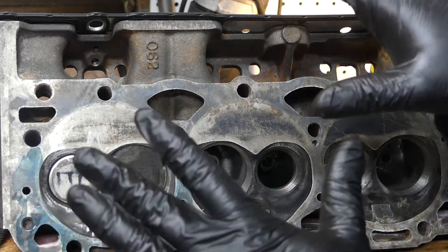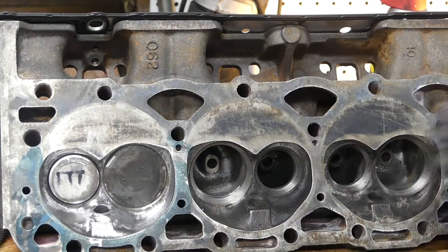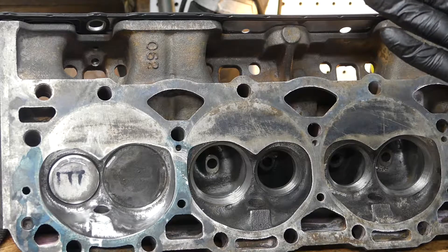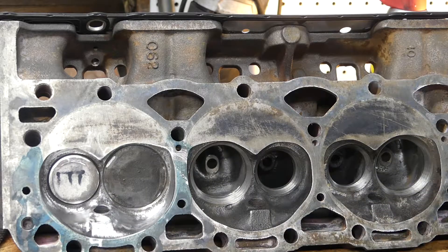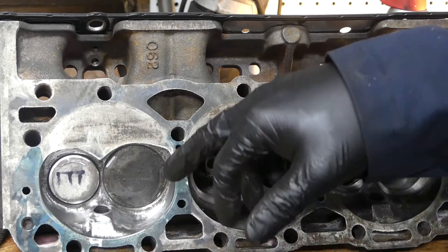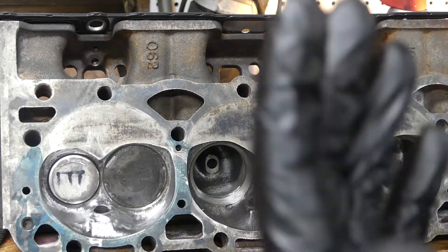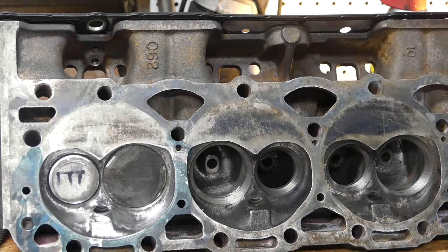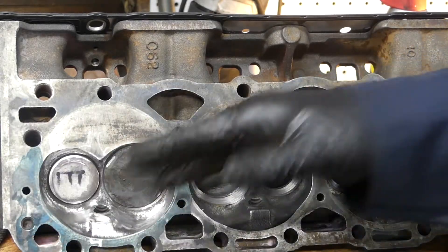I just finished this chamber. I didn't go crazy doing it — I spent about 15 minutes on it in total. I unshrouded the valves and polished up the chamber some, and that's it. Realistically, anything more than this is just cosmetic and you're not really gaining anything. You can dig in and reshape the port a little bit more, especially if you're going to be angle milling, but for a basic in-and-out port job you're just going to unshroud the valves a little bit in the chamber, break all the edges, and polish the chamber out some.